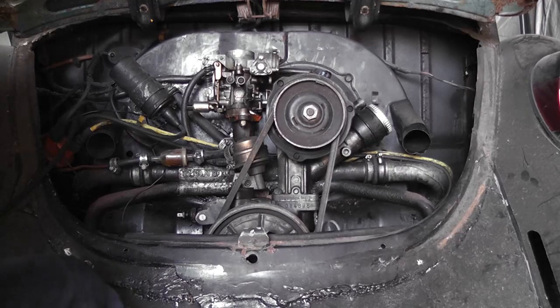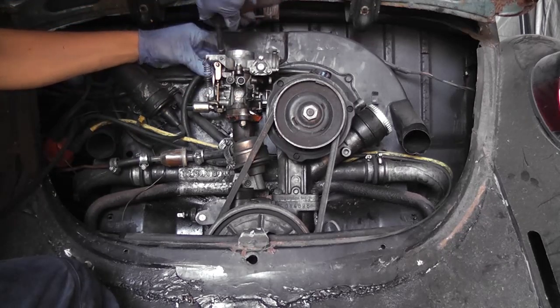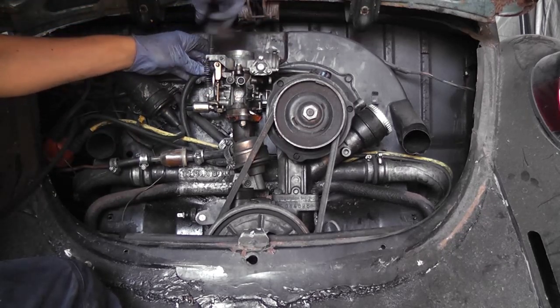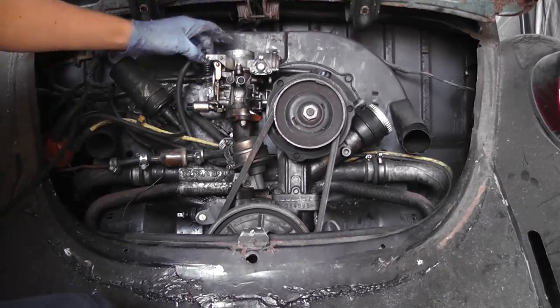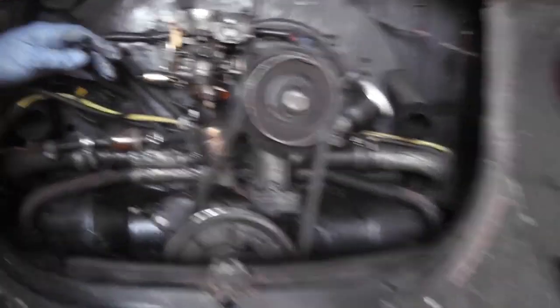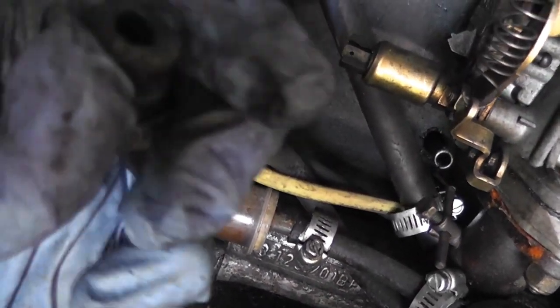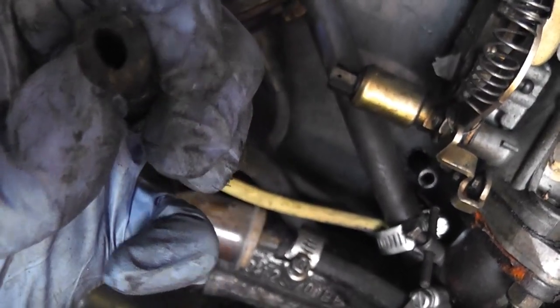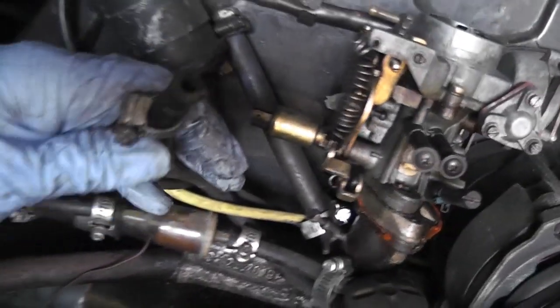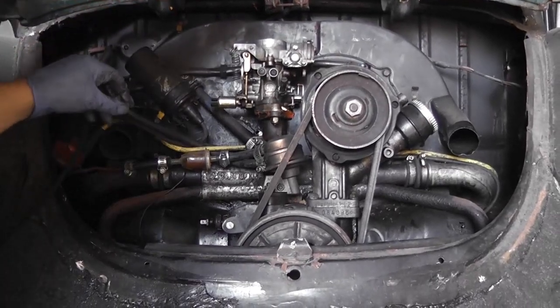Now let's take that fuel line off and have a look at the state these fuel lines are in. Well that's loose anyway for a start. What we'll be doing is replacing all of the jubilee clips with proper hose connectors, and the one on top of the carburettor I will be lock wiring in place — because what can happen sometimes is the brass fitting pops out of the carb. It is a major problem with beetles particularly because the engines are more prone to going on fire because they run hotter. The fuel hose superficially doesn't look bad, but that's not to say we won't be replacing it — you'd be mad not to.